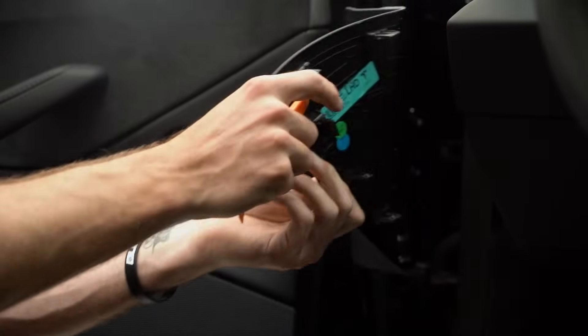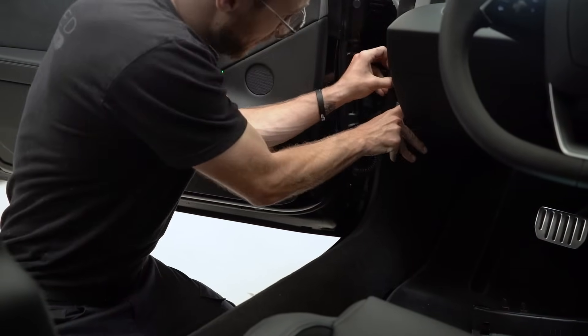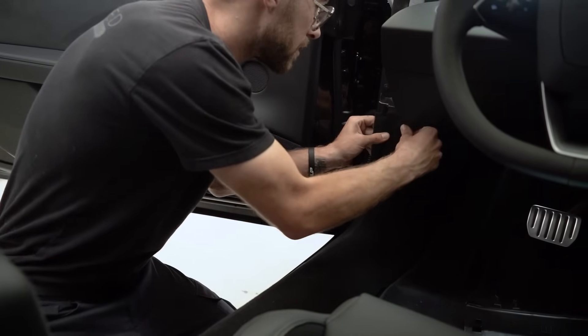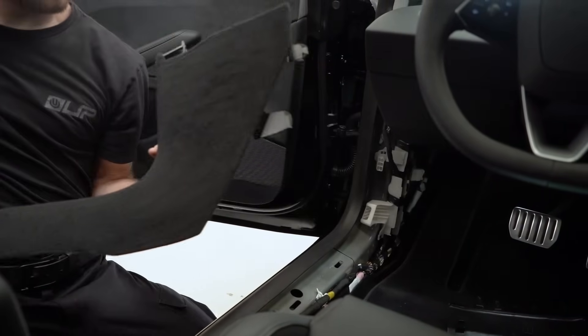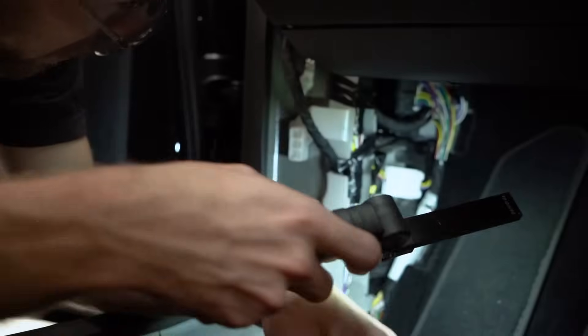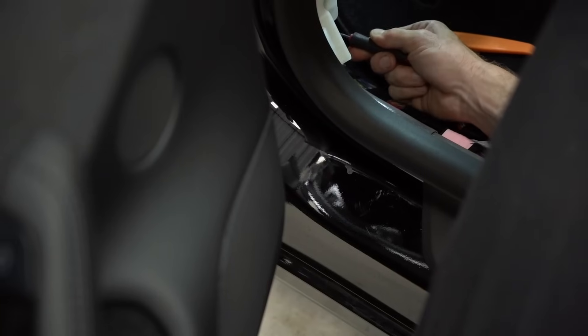It looks like it's just pull clips. This is all disconnected — slide that out. The dash isn't impacted here, just pull back and slide right out. I see a very similar looking mounting point. Let's go ahead and get this harness disconnected. I think it's going to be a push-pull clip just like on the last one. Things are looking very, very similar to the first gen.